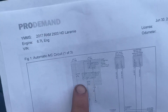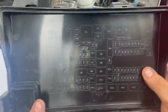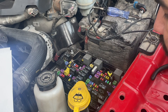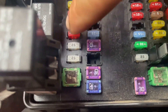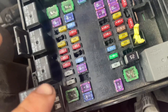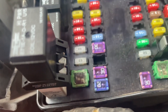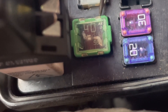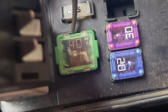So now the question is what's going on past the relay. We're moving to fuse 13, the 40-amp fuse, which is located right on top of K16. It's a J-case fuse. When we look at it, it doesn't appear visually busted, but when I take off the little window cover and move it slightly — check that out — there is a spark inside the fuse socket, and I can actually hear the blower motor turning on.